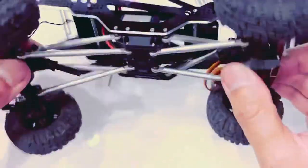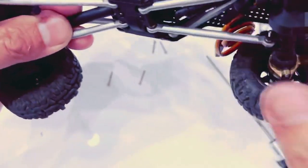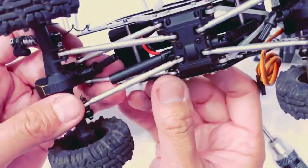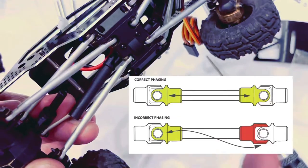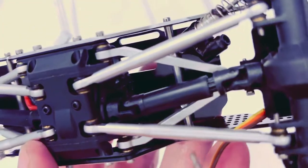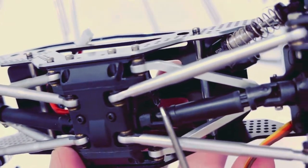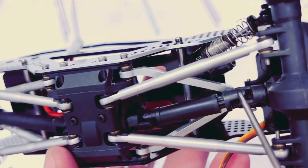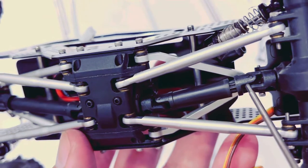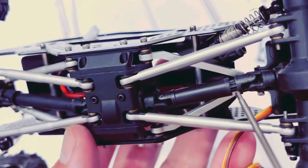Before we install the shocks, remember we need to align the drive shafts, because once we install the shocks the drive shafts are going to be hard to align. I'm going to put a photo on the screen of how the drive shaft needs to align, because you can't just stick it in randomly. There is a particular angle. Basically this drive shaft from the main piece has a tab that comes up, and this needs to mirror that — think of it like a dog bone. The tab can't be rotated 90 degrees or it will create binding and won't articulate the way it needs to.